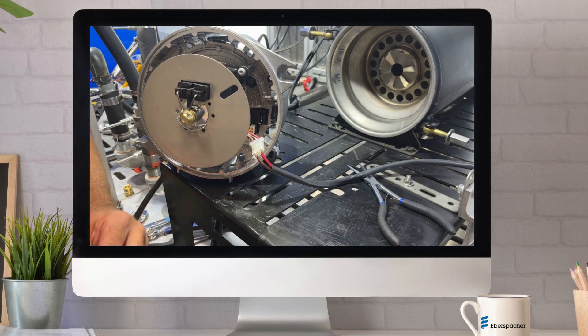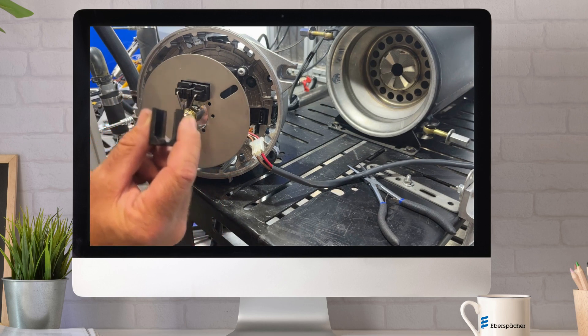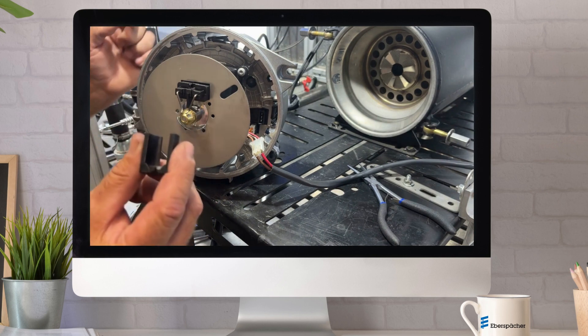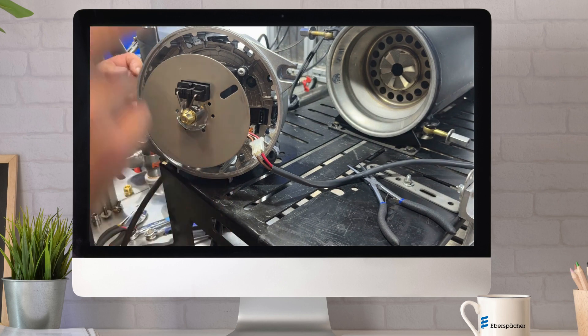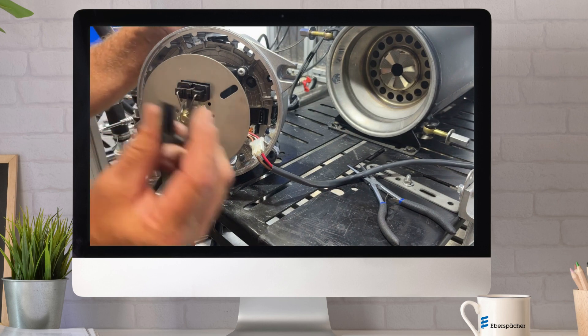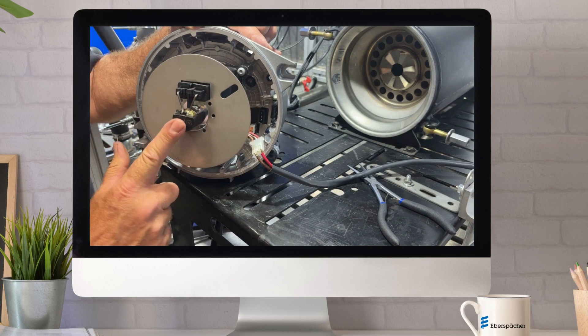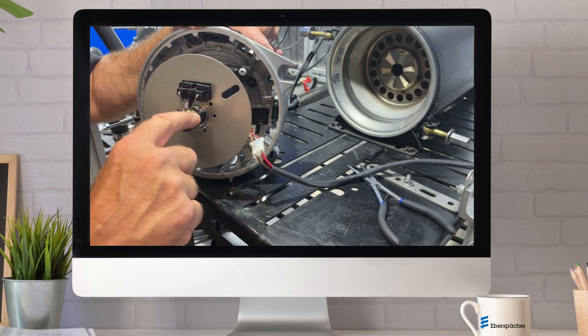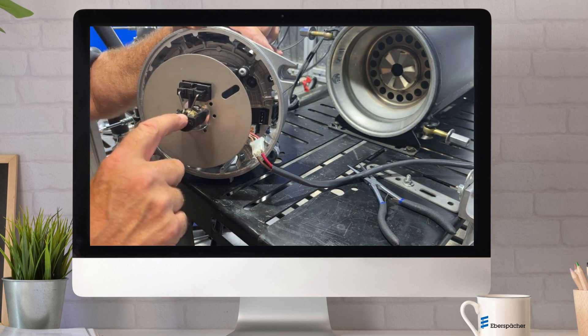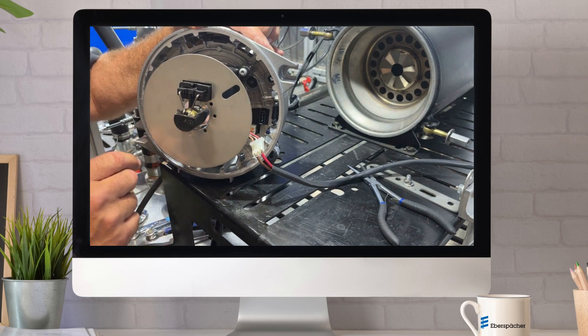At this point, we're going to look at your ignition. There is a gapping tool to check the gap on your electrodes. The gapping tool is purchased when you actually purchase the electrodes. To use the gapping tool, it gets pressed up against the nozzle. The electrodes sit flush in the gapping tool up against the tine in the center.